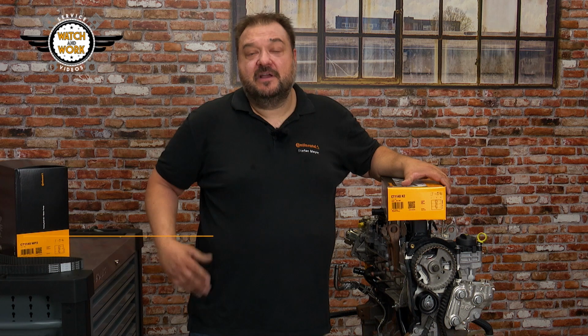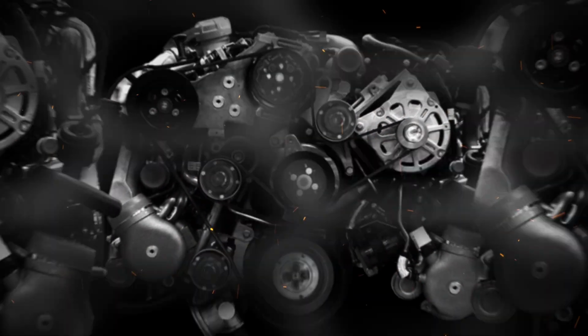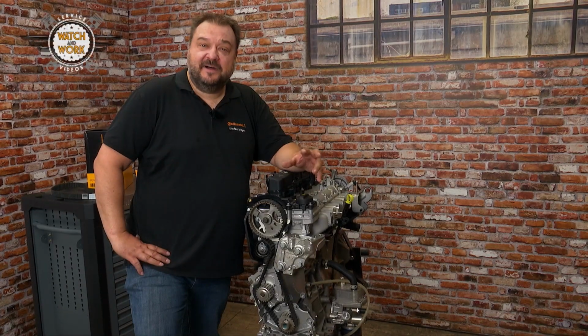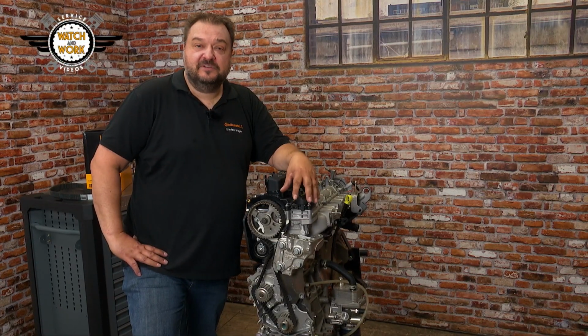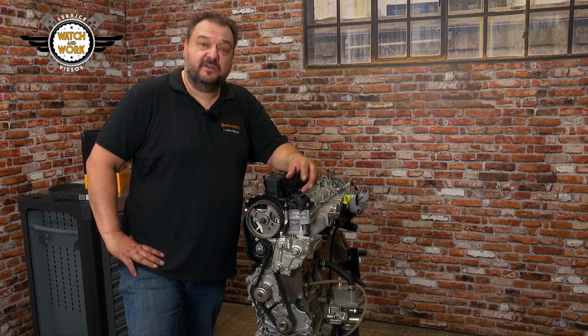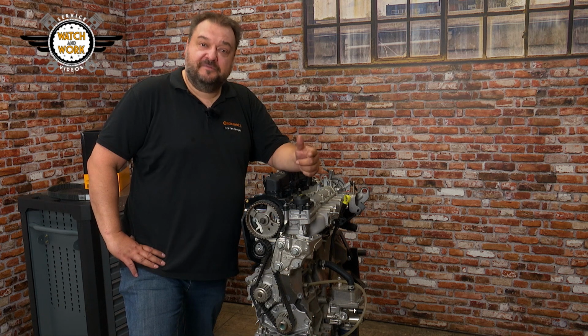Hi guys, today we're looking at tooth shear on the CT1140 K2 or WP2 related to work previously carried out on the high-pressure fuel pump. This affects 2.0 and 2.2 liter HDI, Blue HDi and TDCi EU6 engines from Opel, Ford, PSA and Toyota.